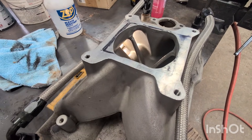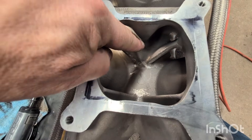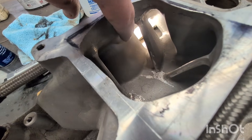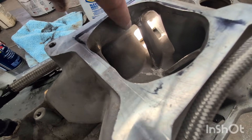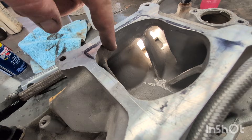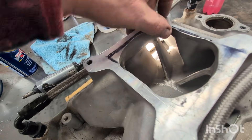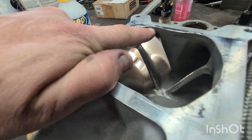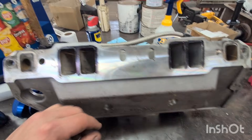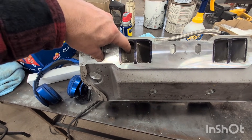The main focus is going to be trying to take each port — we have this curve to it — and imagine if we can start to straighten things out. We're limited by how much material is inside the intake to be able to straighten things out. If you look through here, what I want to focus on is this edge and this edge, the same thing all the way around. We want to straighten out the port. Also, think of this edge here like a 90 — obviously it's not a 90, but I want to get rid of this edge right in here. I want a smoother transition coming up into the pad itself. Anything that you feel has an edge to it, we want to round that area up — but not to the point where I'm flat against it. We want a smooth transition going into each port. We've just got to straighten out some of the ports. You don't need to go all the way in — just go in about an inch, inch and a half. That's all you really need to do.